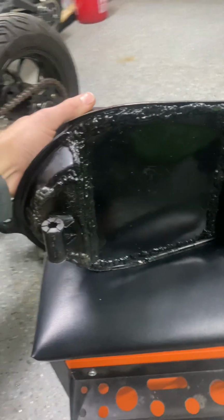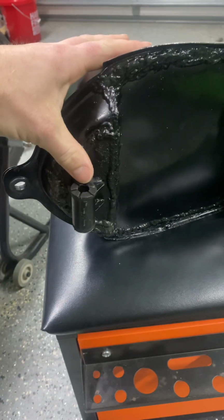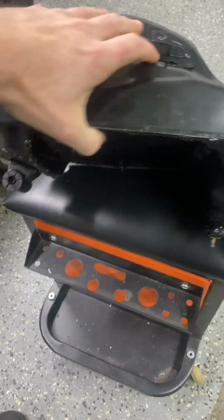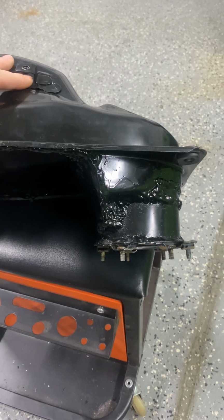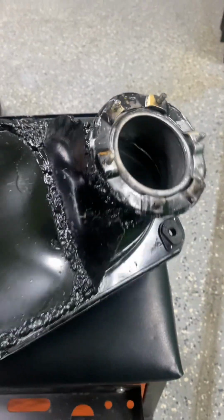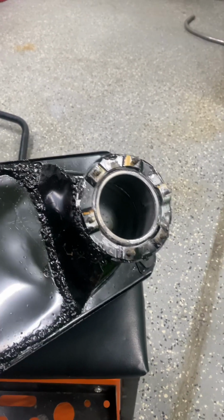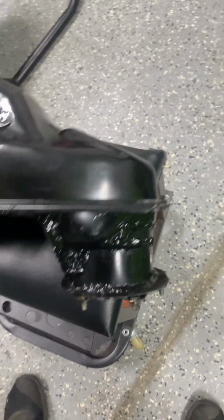So I put it up, but I cut off basically the bottom, kept this factory mount, and then cut the bottom out. You can kind of see in the profile. Basically took an inch and a half out of it, and then I made my own jug to fit the factory hat. That's the factory hat or fuel pump adapter off the CB500F that I welded in there so that the pump, if I can get this to work out here.